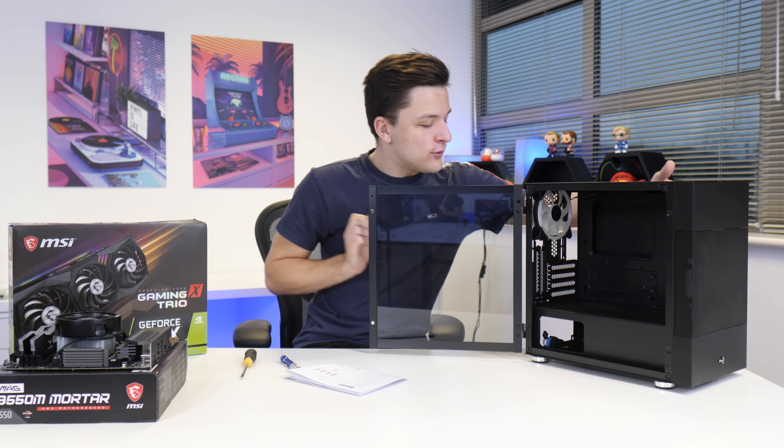Spin the case around to the back and you'll find a little bag with all the screws we need to install the motherboard, as well as pre-routed managed cables — genuinely impressive for a budget case. Now we just need to make sure that through each of the holes on our motherboard, circled in white, we've got a corresponding standoff in our case also circled in white. It's then simply going to be a case of sliding that motherboard into the chassis using the included screws that come with your case.